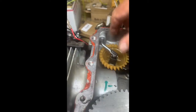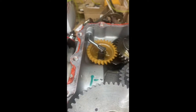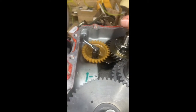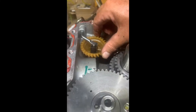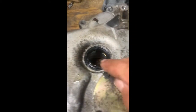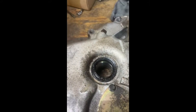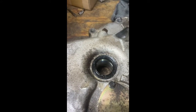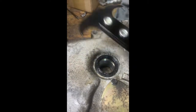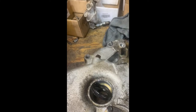This right here is called the governor. It had come undone - Perry did something he shouldn't have trying to get more speed out of the machine, and so the governor came apart and I had to put it all back together. When I went to get the engine back together and put this cover back on, this seal came loose inside, and this spring which is supposed to hold it together came out of the seal. So I have here a seal pulling tool and I'm going to take this seal out. There is the seal.